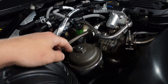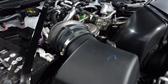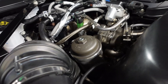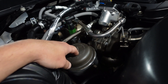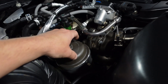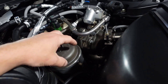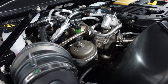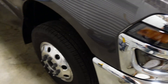Then we can start replacing our O-rings. You're going to have an O-ring on the cap and some O-rings on your filter. Don't put your new filter in until the canister housing is all empty. But once that's empty, we'll lube up all three O-rings and insert that new canister filter all the way down until it's seated. That's going to seal the canister off, which will allow us to pour some oil into the canister housing to prevent a dry start and pre-lube that filter.